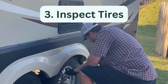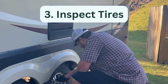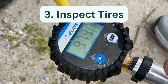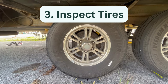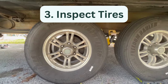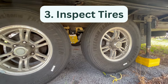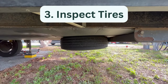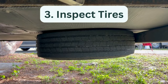Three, inspect tires. RV tires should always be inspected before travel. Start by checking the pressure of each tire. The recommended tire pressure is noted on the sidewall of your tires. Owning your own air compressor is ideal so tire pressure can be adjusted before driving. Also pay attention to the tread depth of your tires and use a tread depth gauge to measure it if needed. Don't forget to also inspect your spare tire. Spare tires should be inspected every 5,000 miles or at least every 6 months if you travel short distances.